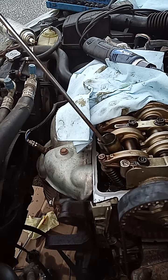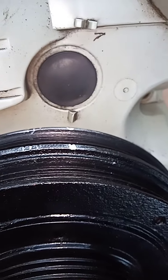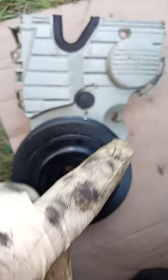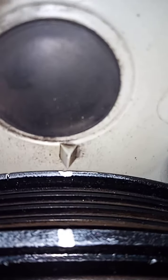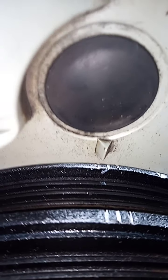On the crankshaft pulley, you're going to see here where you have three lines. There's the three lines right there, and there's going to be a single line. You want to rotate the crankshaft counterclockwise — you want to turn this way — so you want to align this mark with the correct mark. Not with this one, not with that one, not with that one, not with this one, but with this one right here.